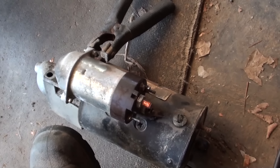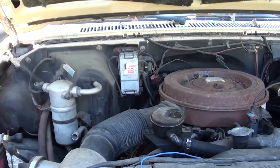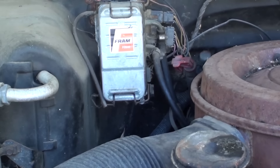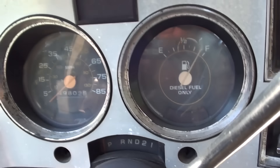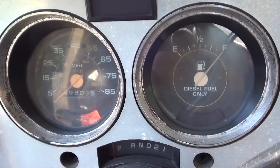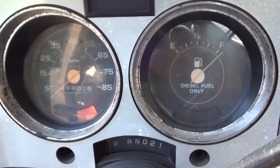Is she tired. You should feel this thing vibrate. So now with the new starter in it, it has no fuel, and we start looking at clues. Well, that's a pretty recent fuel filter, which could mean that somebody was just doing maintenance, or they were attempting a repair. But when we come in the truck and we turn on the key, look at the fuel gauge — it goes buried past full.